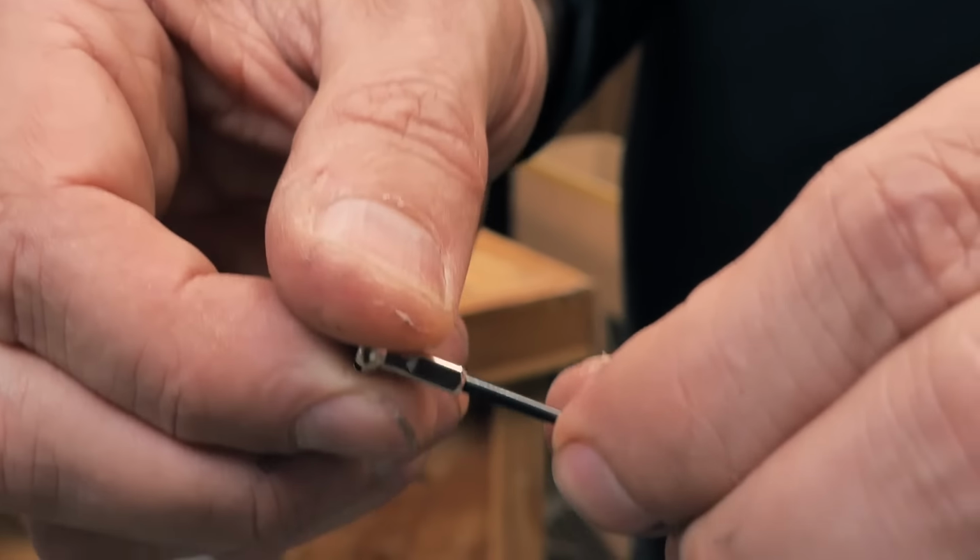So if you have very, very tight spokes, you'll get a very reactive wheel. So if you try and accelerate, it will feel really, really sharp. The tighter you get, the more brittle the spokes get, and you might risk actually breaking a spoke. If they're too loose, you'll find that your wheel becomes quite wallowy and soggy. Trying to find the optimum for your rider preference and their weight is the skill of a really, really good wheel builder. Okay, to sum all that up very quickly, everything should look centered and aligned. If anything looks skewed or forced or strained, that's bad.